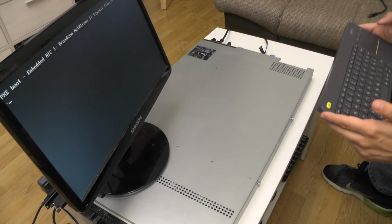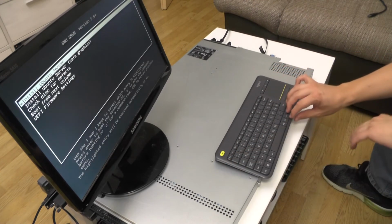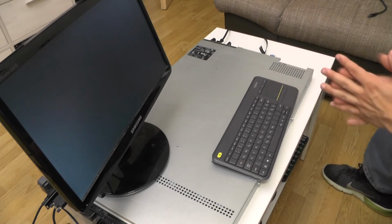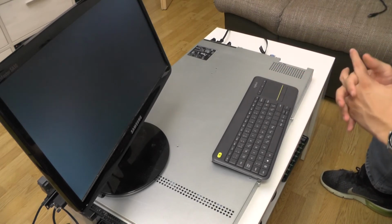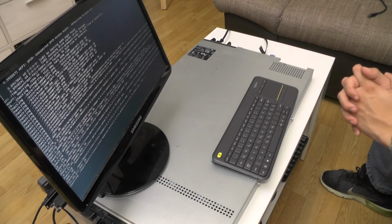We are still trying to boot off of Ethernet. Okay, very nice. So, install Ubuntu server. We don't need safe graphics. This Matrox G200E that is inside is supported very well. You can also run updates for the... Yeah, that would be a good thing to do now.